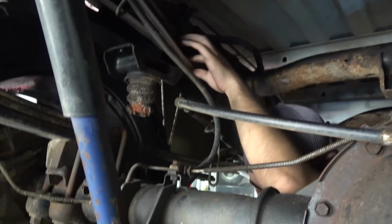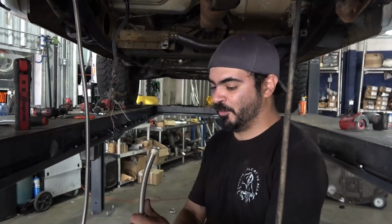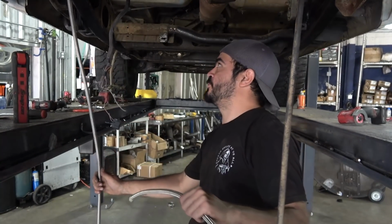Yes. So on this one we're doing 10 feet, 8 return. And that thing about PTFE, while it doesn't permeate and it supports a lot of different fuels like methanol, E85 and stuff like that, if you kink this, it will leak. So you gotta keep it somewhat straight, no hard turns, nothing like that.